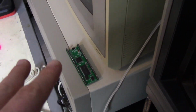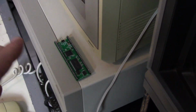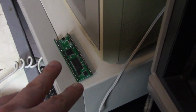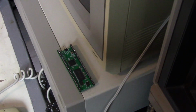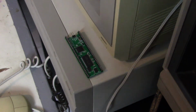And as I said earlier, I did kind of poke at people that put ludicrous amounts of memory into an Amiga. Admittedly, as far as games go on Amiga 2000, you'd never really need 8 megabytes of fast RAM, but that is the max amount that this machine can natively take. When I'm talking about ludicrous amounts on an Amiga, I'm talking about 64-plus megabytes.